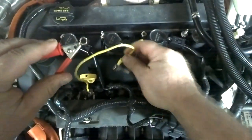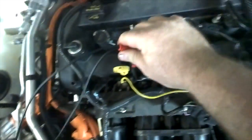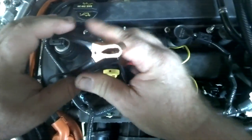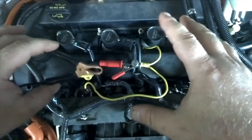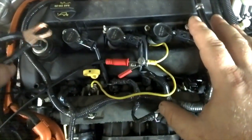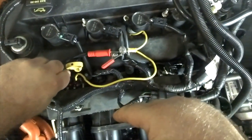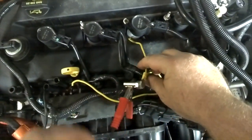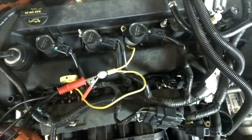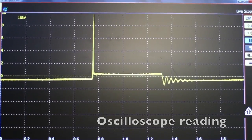Now we simply take our secondary ignition leads — this goes on the bolt right here. We also have a ground strap here too. What this is for is if you have a leakage through the boot on this coil, you don't want 40,000 volts going all the way through your meter and into your computer — that gets kind of expensive. By grounding this out, it's going to discharge that spark right to ground, and you'll be safe, and your equipment will be as well. That's all there is to the setup. Now I'm going to fire up the vehicle and show you the waveform that we picked up.